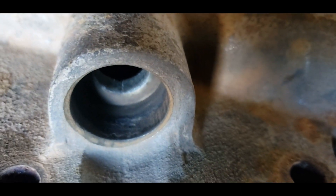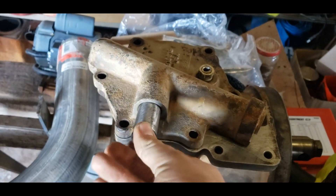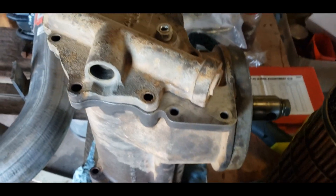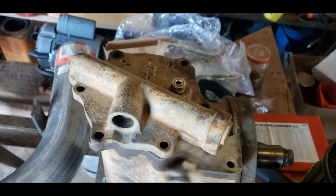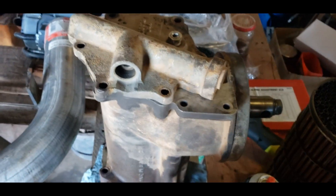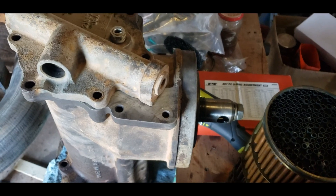For this fitting here I just used generic O-rings from a performance tool kit — a big one in there, plus one of the smaller ones just to help back it up, since the surfaces are a little pitted. This goes in here and then the other end sticks into the block. Got this shined up good with O-rings on it, that should seal. I'll seal the plate that the other end goes into with a new gasket, clean up the other side, mount it on the engine — there's really not much to it.